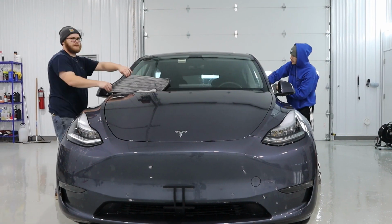And again, the foam mixture that we're using on here was a stripping mixture that stripped off any old waxes or sealants. It also had iron removers in it that would get any embedded iron particles out of the clear coat and the glass. Once we foamed it down again, we used clay mitts on all of the surfaces to remove any embedded contaminants from the glass and paint. Then once we rinsed off the foam from claying the vehicle, we took the Glassparency windshield cleanser and cleansed the entire windshield, rinsed that off, and now we're just finishing drying up the rest of the vehicle.